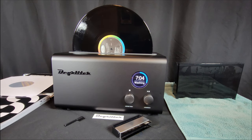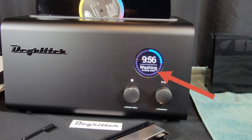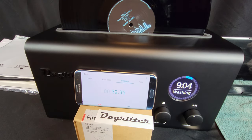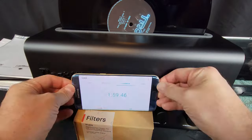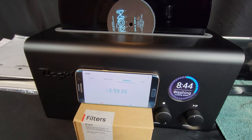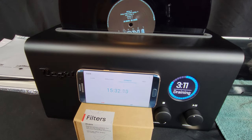The DeGritter cleaning system provides 2 ultrasonic transducers per side. These transducers are known to generate heat, forcing the DeGritter to monitor the water's temperature and cool it down periodically — stopping the cleaning process entirely and just spinning the record while the machine waits for the temperature to drop. This can add a significant amount of time. The first time I noticed it, the remaining time was around 5 minutes, then it jumped up to 8. Only after 2 cleaning cycles, the DeGritter starts to overheat, causing each consecutive cleaning cycle to take almost 19 minutes. The DeGritter re-adjusts its remaining time based on the cooling cycles, and there are so many that it never gives an accurate cycle time. In the time lapse I recorded here, the cleaning time clocks in at 18 minutes and 45 seconds.